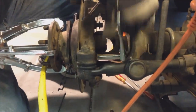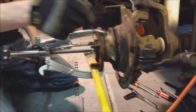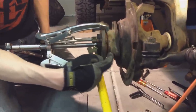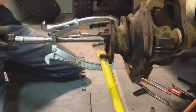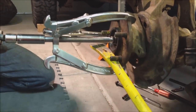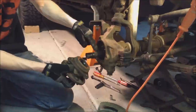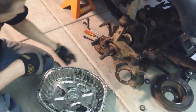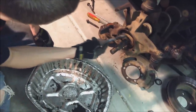Now that we've got it loose, we're removing the hub retaining bolts all the way. We left them in just to help stabilize it while trying to remove it, but now that it's broke loose we removed those bolts to continue pulling the hub. When you remove the hub, be sure you're not pulling on the axle at all, because the axle will pull out since the retaining bolts are now removed. Before we put our new hubs on, we're going to take a wire brush and clean up around the steering knuckle and along the axle — just get a lot of the dirt and rust off.